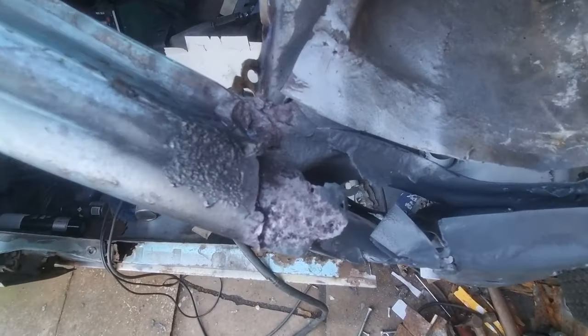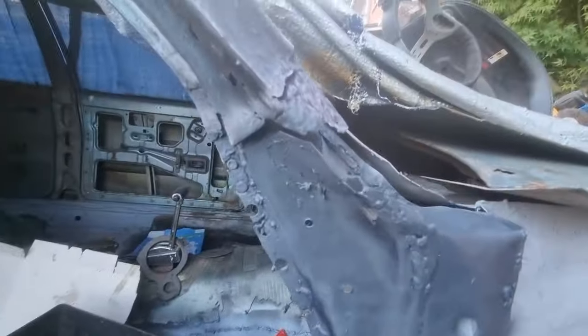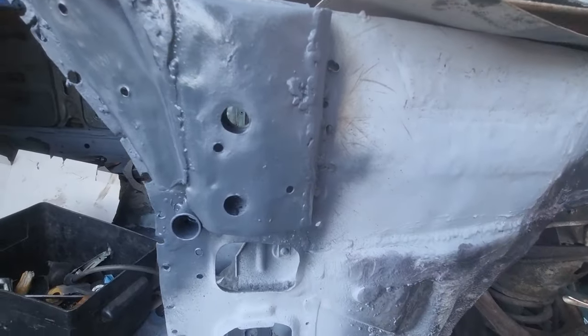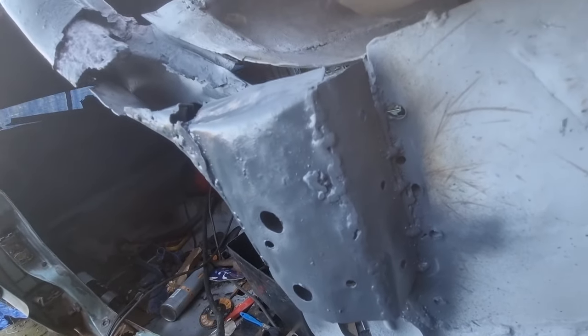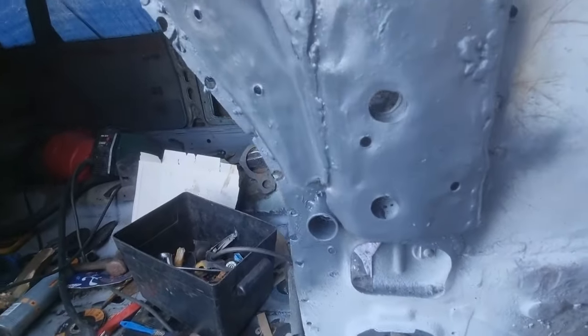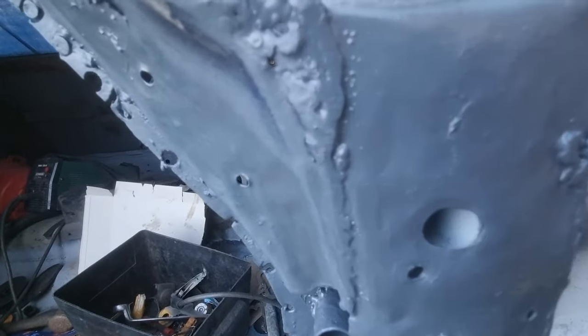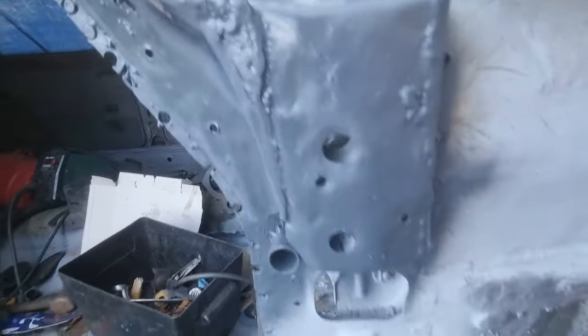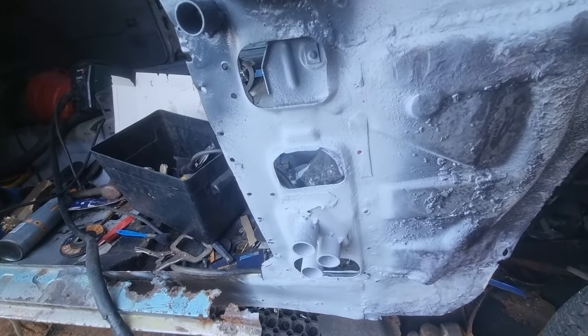Gonna make the top section that comes down here, over the top of there. But that's my own made bracket. All lined up. All spot welds ready. But I'm not, as I said, putting the outer bit on yet. I'm just gonna tack screw that on and test the door, because obviously I want that to come off when I do the seal.